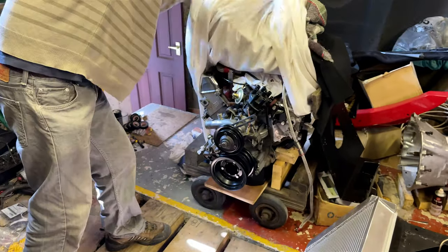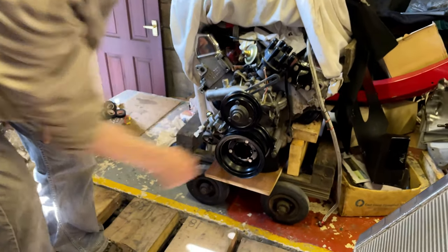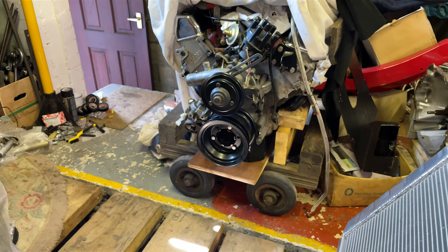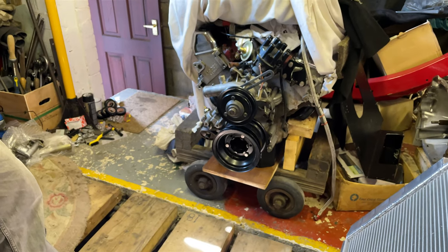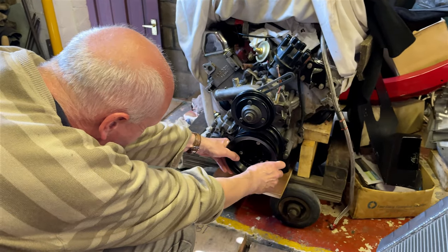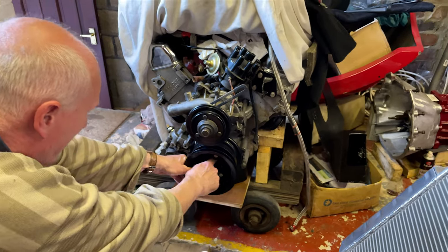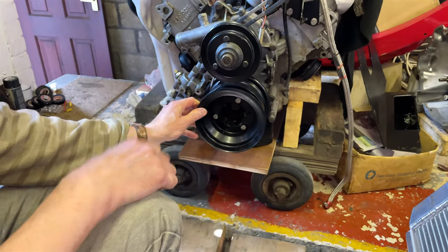Since the last visit Gary had got the crank pulley off and done quite a lot of cleaning on the engine over about six weeks. He'd tightened the pulley up to about 90 pound-feet of torque — the spec says around 150 — but he applied some thread-lock to compensate, so it should be all right.